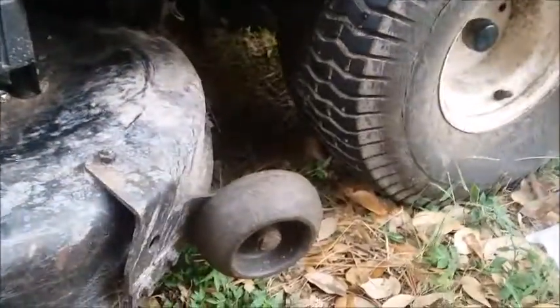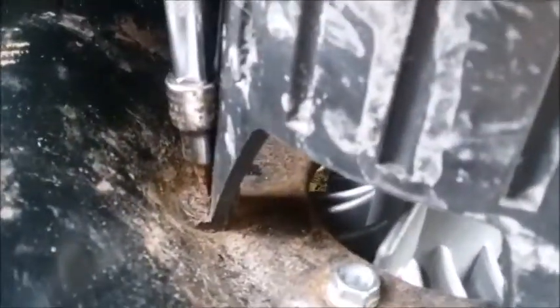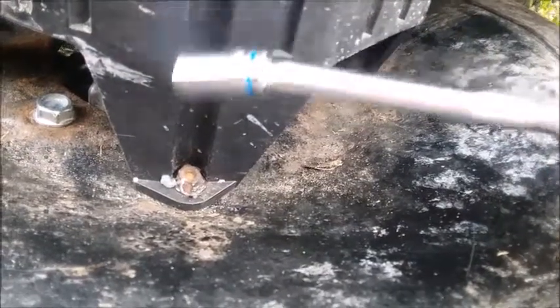What we did was use something to pick all the dirt out of the area of the nuts. At first we didn't realize there was actually an allen set head in the center of the nuts. It was a lot more difficult trying to get a socket to fit in there - very difficult because of the angle. Using a quarter-inch drive with an extension, that was able to get right on top of the nut and be straight up and down. It's a 9mm socket that fits on top of these nuts on that plastic housing.